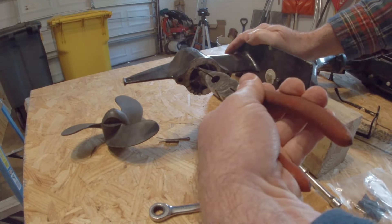Another thing you want to check while you're in here is this space — how is it looking? Has it got buildup of crud? Is there any corrosion in here? This thing looks really good. And here's one of our water passages — maybe that's the water intake right there, and then this is where it goes out. That's such a crude, basic system. You see these little notches here — that's where the water actually comes into the water pump, through these spots, and it goes out there. It's such a small motor that's all it does.